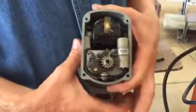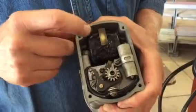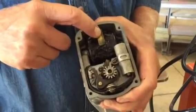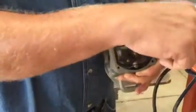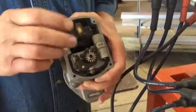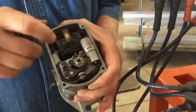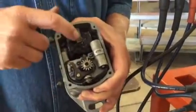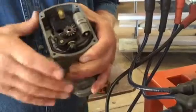The same thing on a FMJ, which is a more common mag. This one again has the old-fashioned coil. This lead should be maybe a little closer to the end, because if a spark has no place to go, it should be able to jump to the housing. If you've got a spark plug wire that's fallen off and the spark has nowhere to go, the coil either has to eat that spark, which is very hard on the coil, because it's going to probably jump through the insulation into the housing, ruining the coil over time. One spark won't do it, but anyway, this one should have a distance where it can jump to if it's in good shape, and it won't hurt the coil.